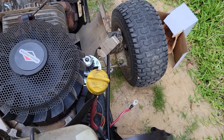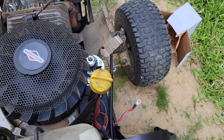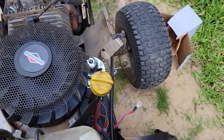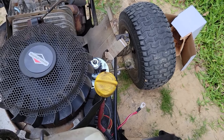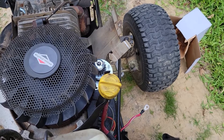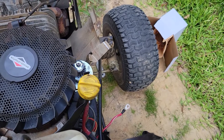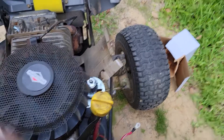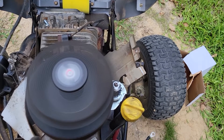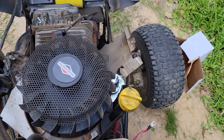I changed to 2-gauge wire because the original wire had been burnt in two from repeatedly trying to start it. It also burned up the starter solenoid. So when I replaced the solenoid, I decided to move it from the back to the front so it's easier to work on, and I changed it from a Craftsman scooter-type solenoid to a real automotive Ford solenoid. Every bit of power from the battery is now delivered directly to the starter. Let's try it one more time. Doesn't that sound like a Ford firing up? I think I'm done.